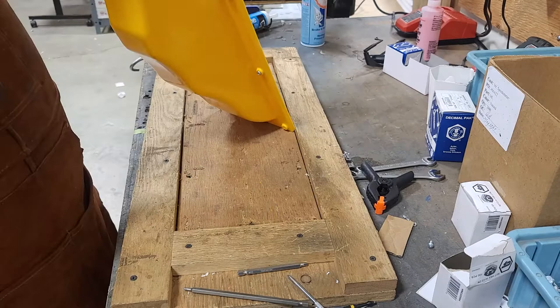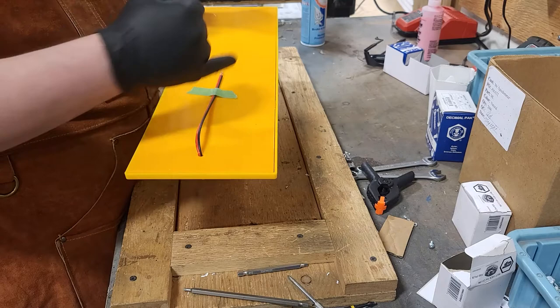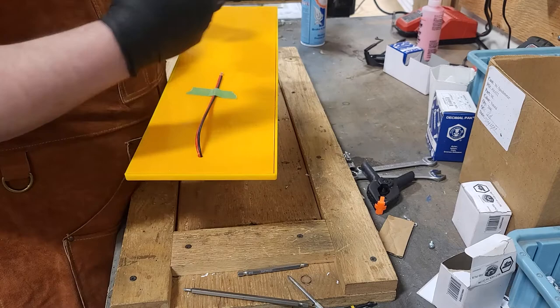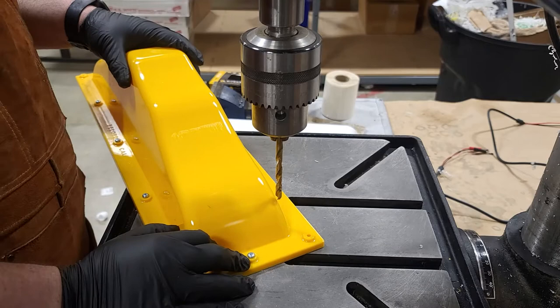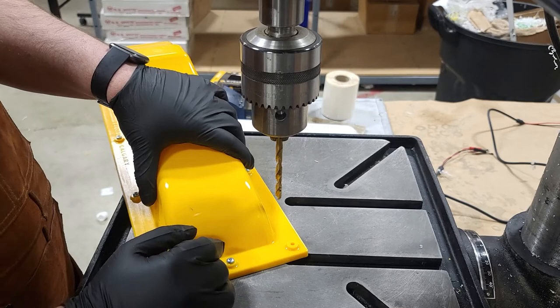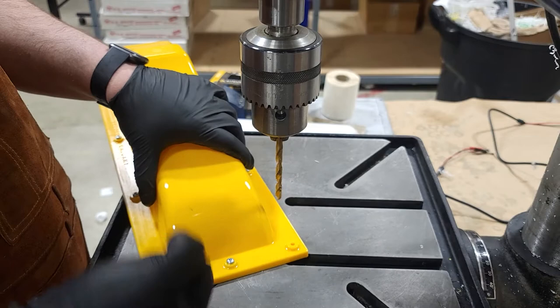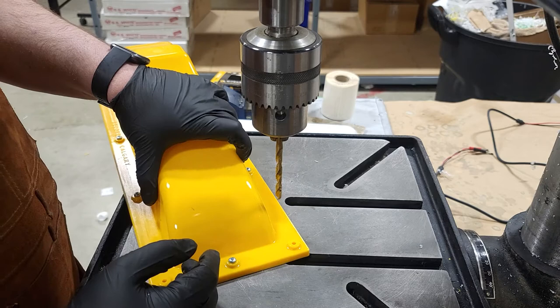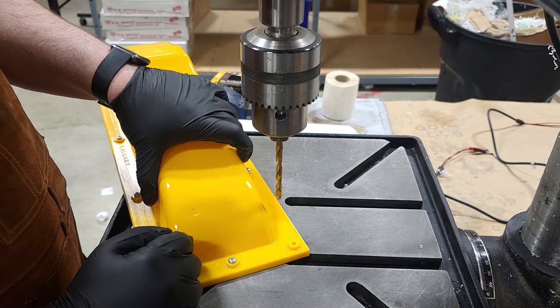Now as you can see, that's all put together nicely. I've been handling this and I've got a couple little dots of silicone there, but nothing egregiously pouring out the sides, so I know I did a nice good job — there's not too much in there. Now it's time to drill the corners out. Something I just remembered — a buddy of mine years ago was watching me do this and asked me why I wasn't using the torque settings on the drill so I could just pull the trigger and once it clicks it's done. Have that not work a couple of times on something like this, having to strip the thing out and redo the entire base a couple of times, and then you'll know exactly why I don't do that.